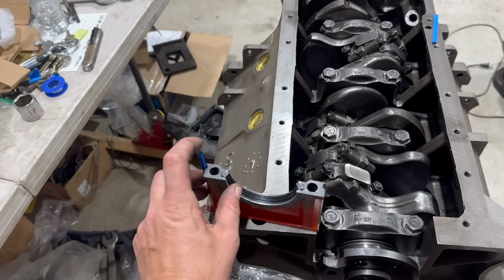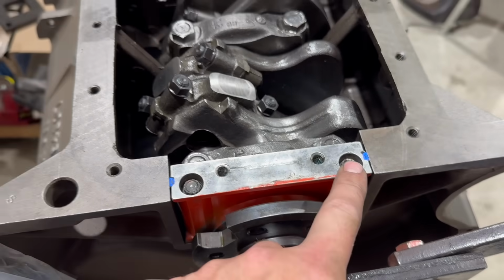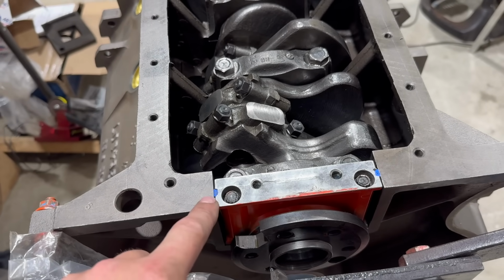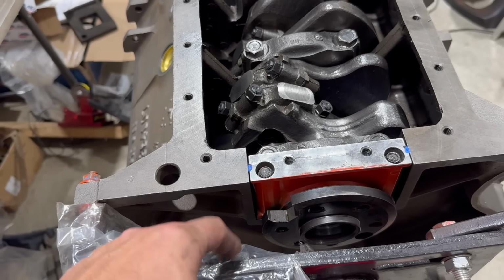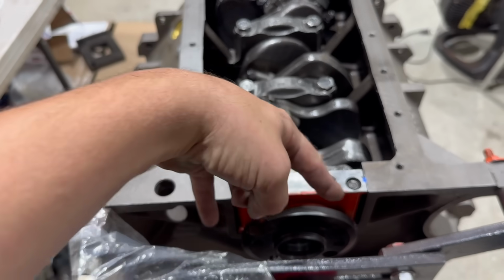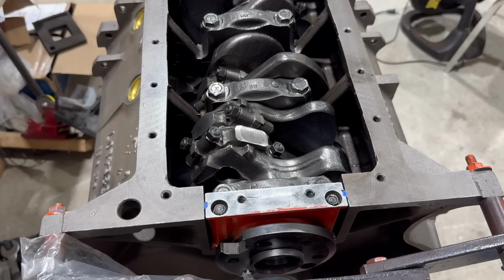So then as I'm dropping the cap in there, they'll gradually slide into position here. I always start these bolts a little bit before the cap goes all the way home, just to make sure everything's aligned. I did notice once it was in place, these are a little below flush. I know they bottomed out down there, so I don't know if maybe this time the cap compressed them a little bit as it went down. I'm gonna hit it with some silicone here and hopefully that's fine.